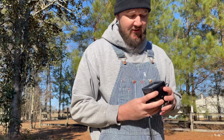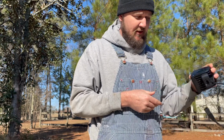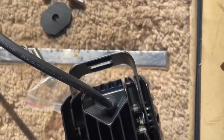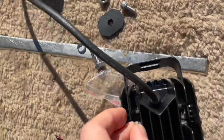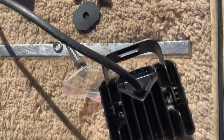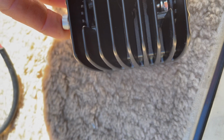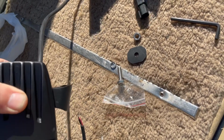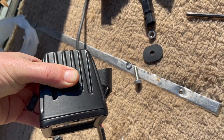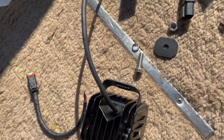So I'm going to get my Allen heads in here and get them roughly set up, and then I'm going to drill my holes in the tabs and we'll get these mounted up. What you have on these is a lock nut. Obviously you want to face the nylon toward the end of the light, and then they just drop down into these slots and the slot holds it. Then take your bolt. You can see how this one was done. You just slide it through. I'm going to have to put the phone down, I can't hold the phone and do this, but that's how the bracket mounts. The bracket also has a slope to it. I faced it so that as the light is facing back, I'll get a more downward motion. Obviously flip it up and it'll give you more of an upward motion, so just be mindful of that if you go with these.